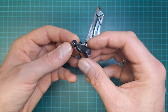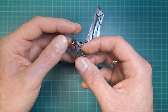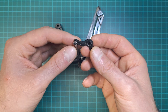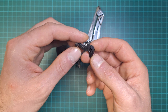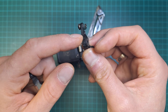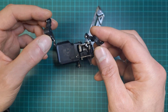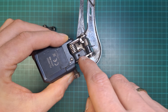The actuator arm sometimes snaps. This one is from Ultegra, but you can use one from a 6770 Ultegra, 6870, 8050, 9150, 9070, and also if you're lucky, you can use one from a GRX 815 11-speed — the same linkages are on a 105 and 12-speed and the latest 12-speed GRX. The main difference between these linkages is that one is cast alloy and the other is steel, so it's very unlikely — borderline impossible — that the steel one is going to snap. So if you get your hands on a GRX or 12-speed 105 linkage, that's going to be much better. Size-wise they're exactly the same; the only thing to bear in mind is the spring and the little plastic spacer are slightly different.